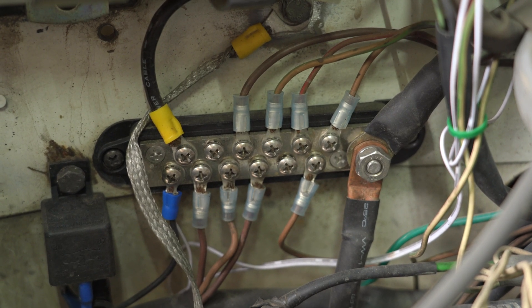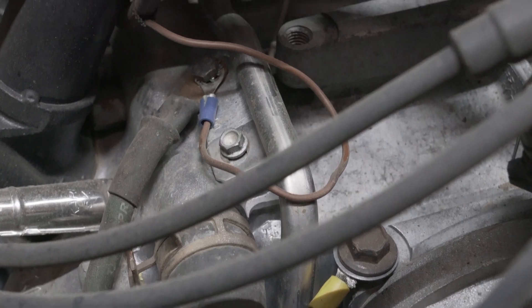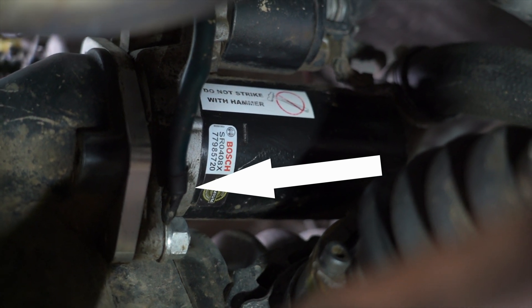While the engine was out at Rocky's being rebuilt, I took the whole engine compartment, cleaned it all up, and cleaned up any wiring. One of the things that Volkswagens in general — I've been working on Volkswagens for about 30 years now — aren't known for is great grounds, and the Westies and Vanagons are no exception. They're all cobbled together on the firewall side, old and corroded. So I took them all apart, built all new ground cables, and made a ground tree back there so all the grounds from the engine and other parts don't have to go through one or two bolts that we hope is a good ground. There are two grounds — one goes from the block of the engine and another one comes from the heads — and then I have one four-gauge or two-gauge ground wire that goes from the ground tree all the way up to the battery negative cable as well. I also grounded from the starter housing to the frame when we put the TDI starter in the van, just one more path for the grounds to get through so it doesn't go through parts of your engine that it's not supposed to.